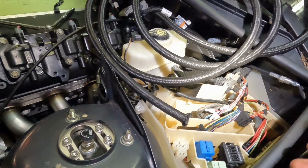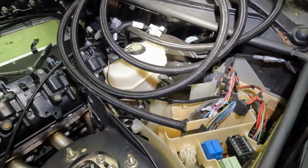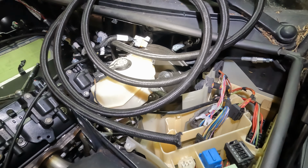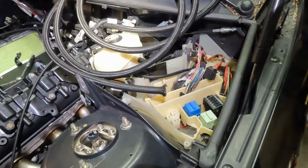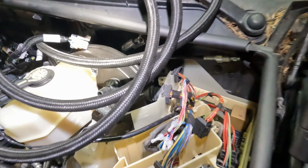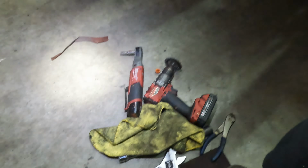This is your ECU box in the engine bay. There's a passage from inside by the driver's seat. If you look up next to the clutch pedal, and you have a light in here, you'll actually be able to see the light and easily pass a wire through. So I'm going to show you where there's a triggered key on and cranking 12 volt power.